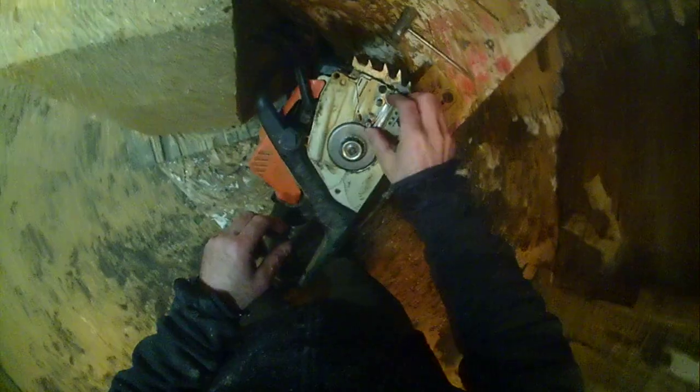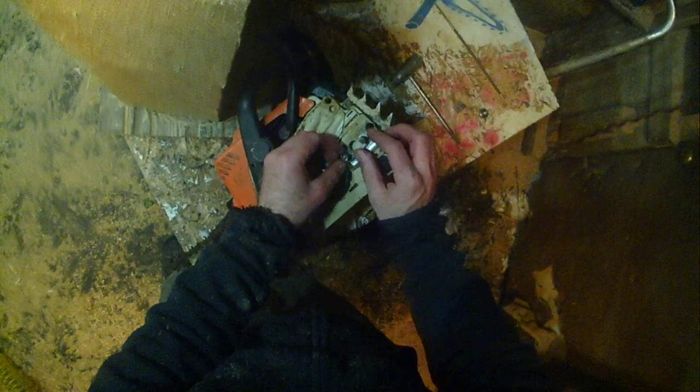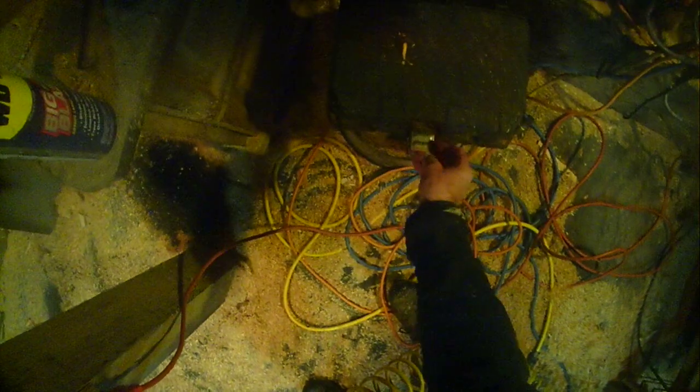But I also modify my own bars, make my own bars. That is one thing that after years and years of doing this, I've noticed a big difference, and the more ability I have, like you saw this kit in here, the Granberg Field Breaker Mender, that's for chains. That's my box of rivets and presets. Pretty much I take that everywhere I go on a job. If I have lots of bars and lots of saws and chain, I can size my chains down on site. I don't have to go to a shop, which is great.